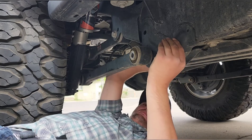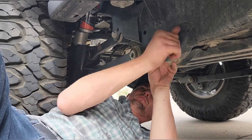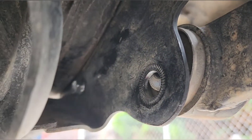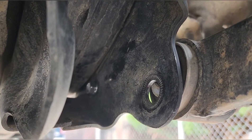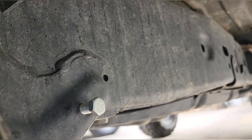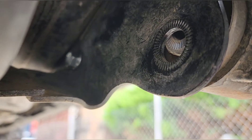So let's get started. It's a bit tight in there. I got my nut started — you have to put the nut on the inside for your front bolt. So what I'm going to do is use some electrical tape to hold that in place. I've got the bolt on the other side, so I'm just going to use some electrical tape to hold it in place so I can get the skid plate in, get the control arm in, and this top bolt up there.